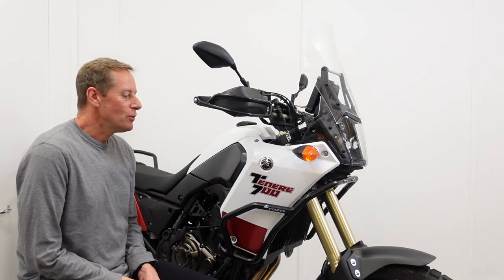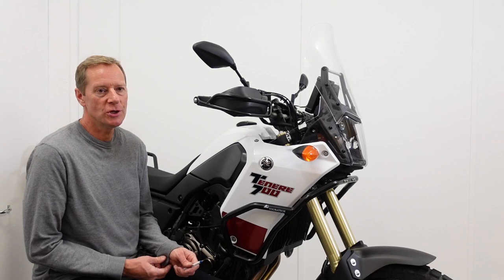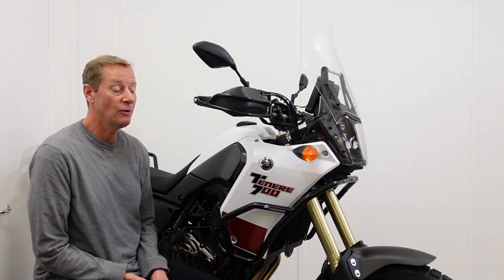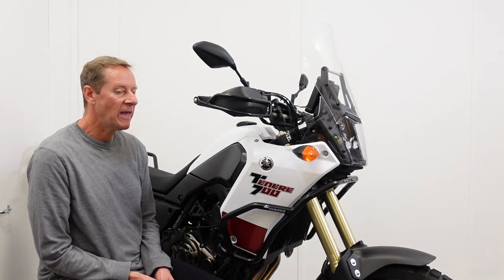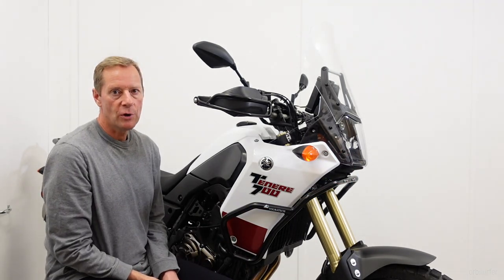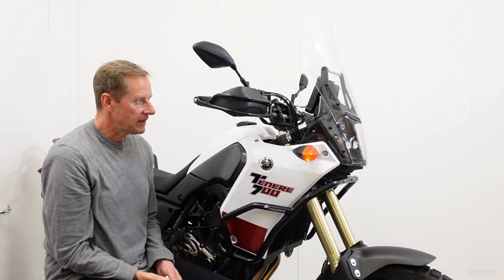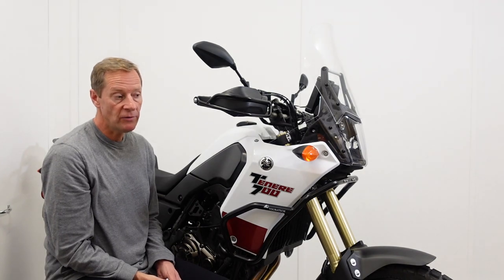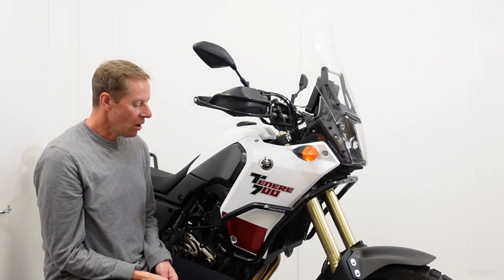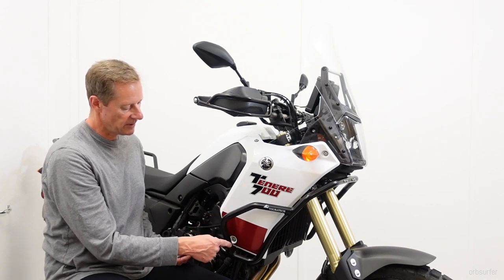So what's my conclusion on the Turatec upper crash bars? The instructions are somewhere between a small puzzle and a joke — pretty bad. Some of the fastener choices are poor, like up at the headlight. If you don't use the original spacers you'll crush the composite material the headlight surround is made of, so you have to use them. But then you have to bend the yoke open slightly, which means Turatec didn't think that through.